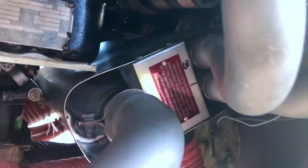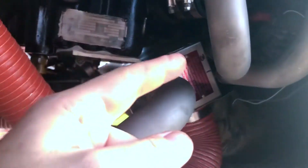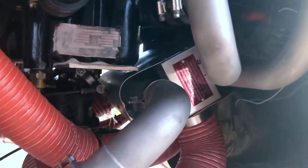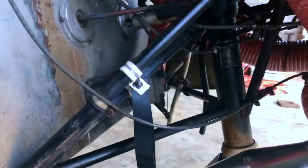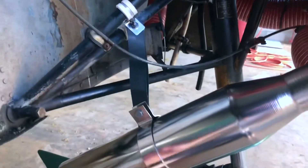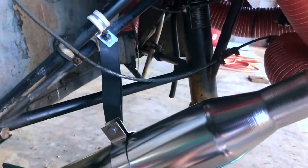You'll notice there are no clamps going from these risers into the central box. That's because these headers are designed to move in and out as the cylinders expand and contract. The tailpipe is attached to the airframe strap — it's not tight yet, but that's okay, it's a secondary.